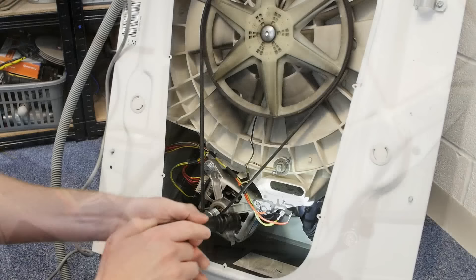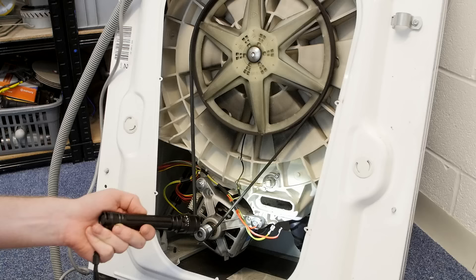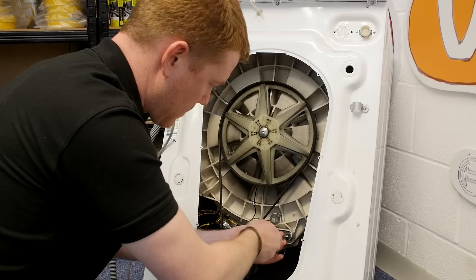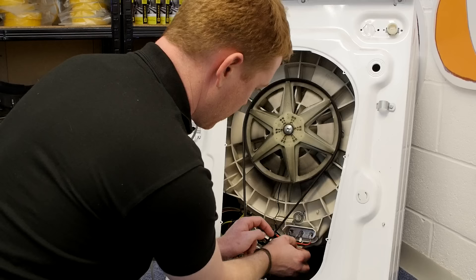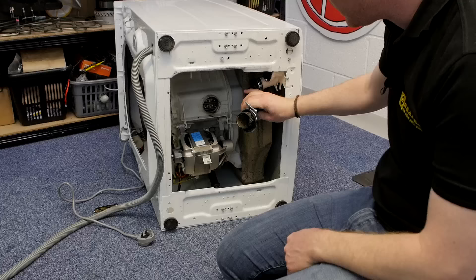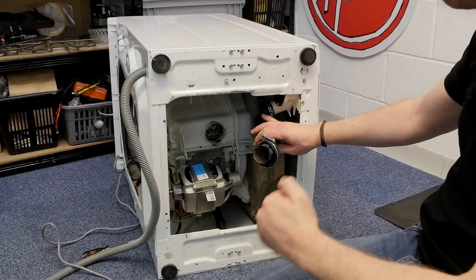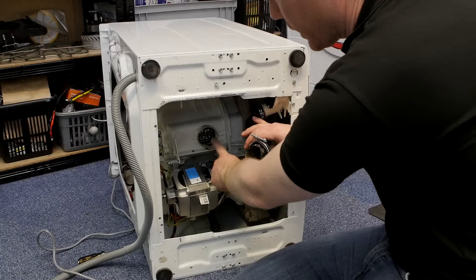Failing that, you want to gain access to the sump hose from the bottom of the machine. In that instance it's better to put the machine onto its side so you can access the sump hose safely. I've put the machine onto its side and removed the base plate, and here we can see the sump hose. I've also loosened the clip so we can ease the hose off, and here we can see underneath the drum. You could also tilt the machine back upright and use a torch to shine through the perforations, and if you see an object you could push it through and access it via the sump opening.